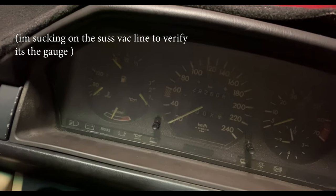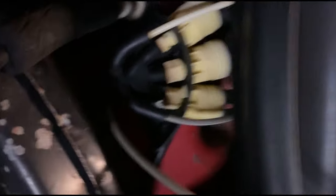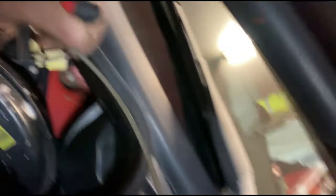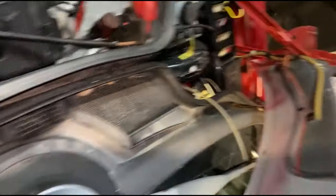My economy gauge vacuum system used a white and gray vacuum cable, neatly tucked away down there. I started pulling on things gently and it all looked pretty good. Then I pulled the supply line out from under there - wherever that's broken, that's the problem. Long story short, I found the vacuum leak by pulling on the supply and checking all the hoses - that leads to that which leads to that, pulling down the supply for that manifold.